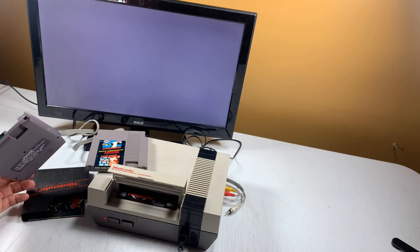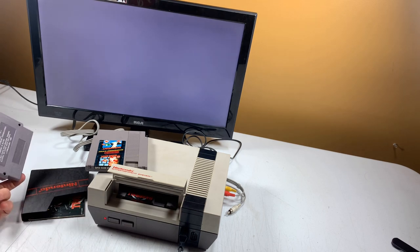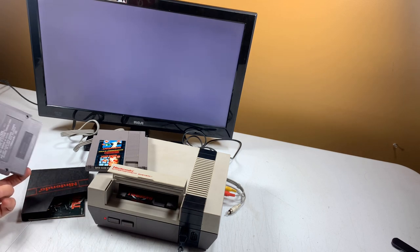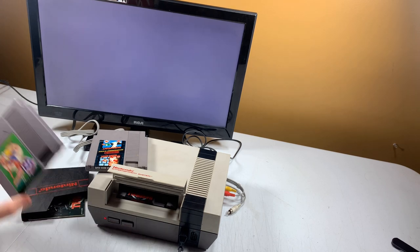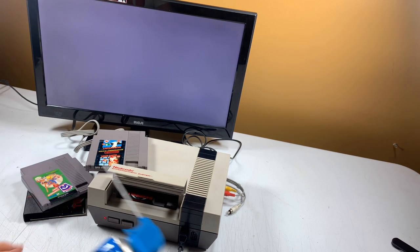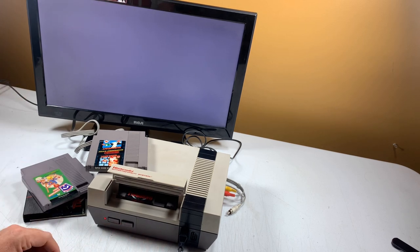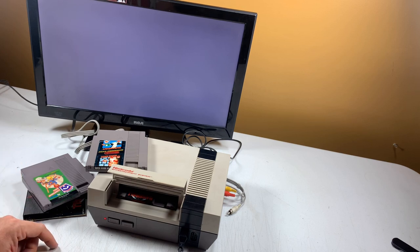market. So the odds of all three of these games not working after I clean them all, especially, and you know, I sell video games and I've sold Nintendos before, so I feel like I know what I'm doing as far as cleaning the games out with isopropyl alcohol, and I use some of this canned air to blow out inside the Nintendo, and it's just not working. It's blank screen, and there's nothing else left for me to do but to try to see if it's the 72-pin connector that's the problem. So that's what we're gonna do, boil the 72-pin connector.